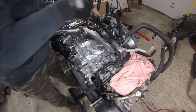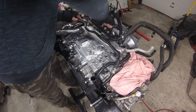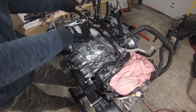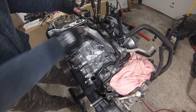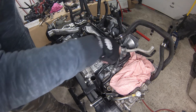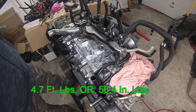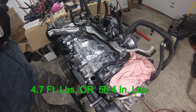I actually have to start this pipe down into the hose here — the forward pipe is for water and the rear pipe is for air and emissions. The same with this hose at the back, which is actually a crank vent, so it needs to be pushed down on here. I ended up taking off the clamp that was on there so we have to install a new clamp. The bolts retaining the crossover pipe are set to 4.7 foot-pounds or 56.4 inch-pounds.